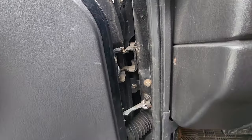Battery. Let's see what it says about the battery. Entering system. Like it's got to hack into the Jeep. Like it's a hacker. Here we go. Go ahead. Go crack the Jeep code. Battery. Abnormal. 11.6 volt. Well, I'm drawing some juice. We got lights on right here because the door's wide open. And we had the hatch open all morning fixing that stupid little latch problem. So, not too worried about that. And let's go back. That's pretty cool.